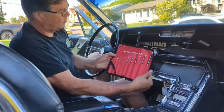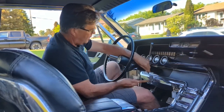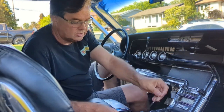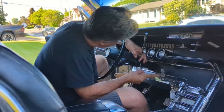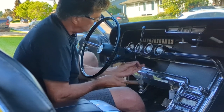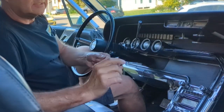I have a set of roll pin punches. I'll try to find the right one — that looks like it'll do it. I think I can poke it up through the bottom. I have a small ball-peen hammer and I'm just going to tap on this roll pin to pop it out. I'm going to go to a larger roll pin punch — the smaller one was going inside it. A 5/32" one is better. There she comes up. I'm going to pop the roll pin right out, then put it back in through the bottom. 5/32" roll pin — I'll just set it there.